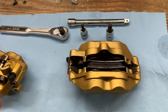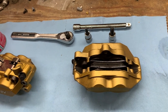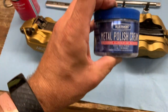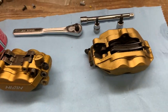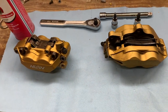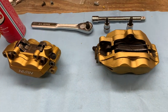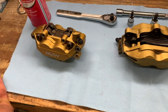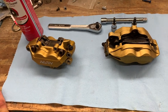At that point we can evaluate the pistons, see if there's any scoring or scarring on them. Polish them up with a little bit of metal polish to make a nice slick surface — not enough to take off the coating — and also do the inside of the cups. Then we'll check out the two different sets of O-rings inside: one's a dust ring and one's an O-ring. If we need to replace them, we can order replacements from Brake Crafter. If not, we'll reinstall them.